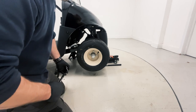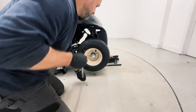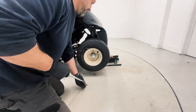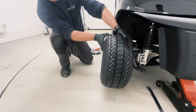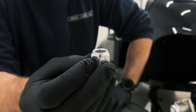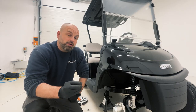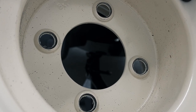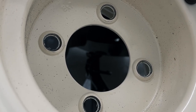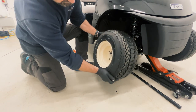We're going to remove all four wheel nuts and remove the wheel. We're now going to refit the wheel. A quick note on wheel nuts — they're fitted with a taper. It's vital this taper is pointing inwards touching the wheel rim. The wheel rim is also fitted with a taper. The two tapers fit together and help with centralizing the wheel into the correct position and grip.